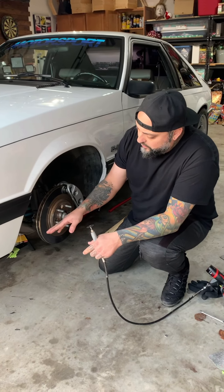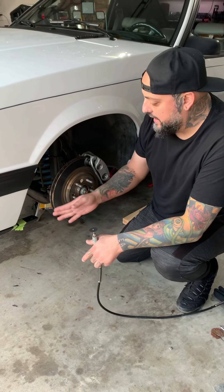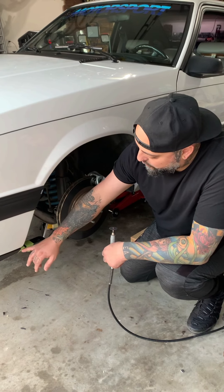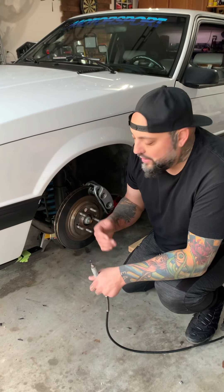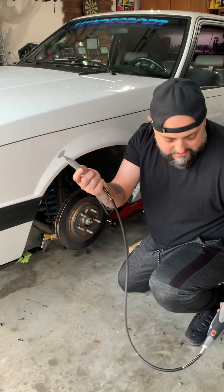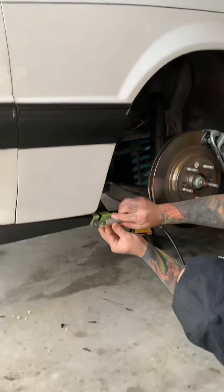We got the whole Mach 1 lip on the actual bumper now — it sticks out about a good six inches, so you have to remove your front tire to make sure you have clearance; otherwise it's never going to work. What I did was put a piece of tape around the actual lip to give me a guideline of where to cut it. I gave myself a little bit of space for error. I'm using a Harbor Freight Dremel with a cut wheel at the end — I first do the grooves and then little by little cut into it.